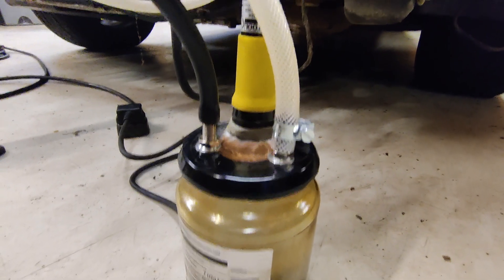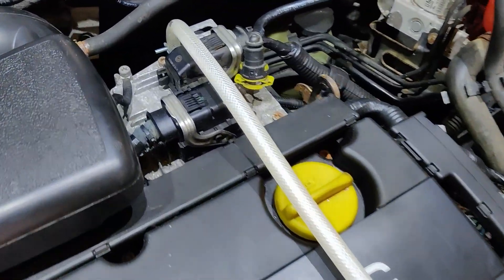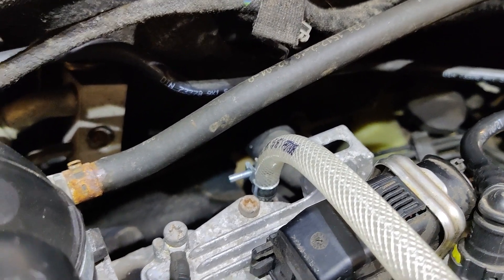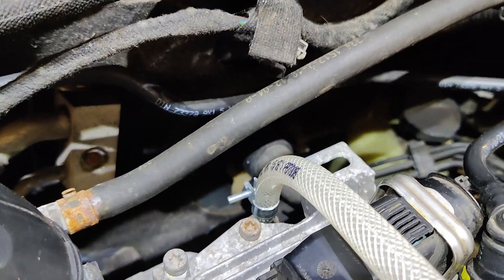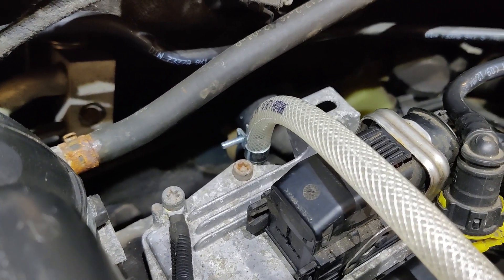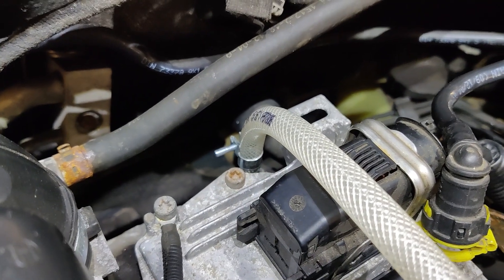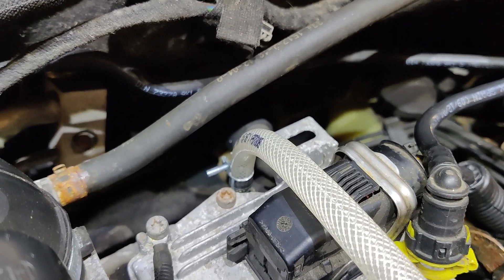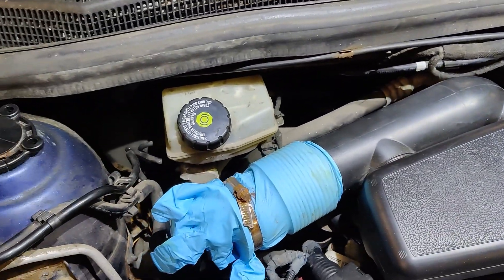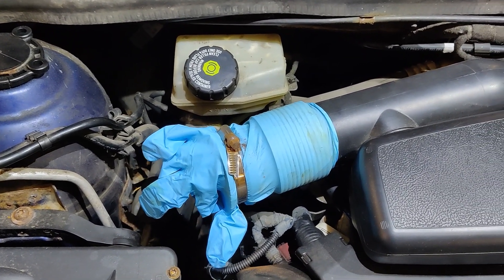Okay, let's see if we can find any holes in our engine. Following my hose up, I've simply connected it to the location where the vacuum hose for the brake servo normally connects. Of course there could be a leak in that hose or in the brake servo itself — it's very difficult to get in to disconnect the other end — so I'm trying this end first. I've taken the air mass flow meter off and sealed the end of the pipe with a glove and a jubilee clip.